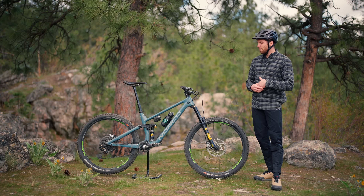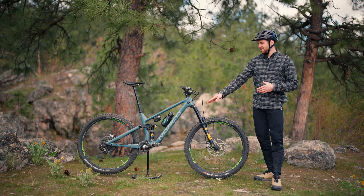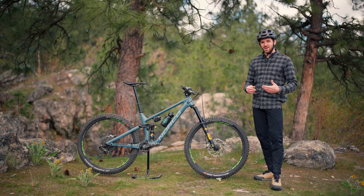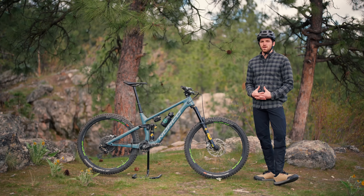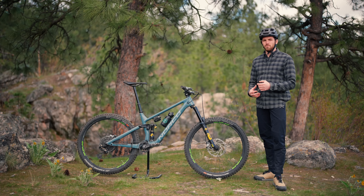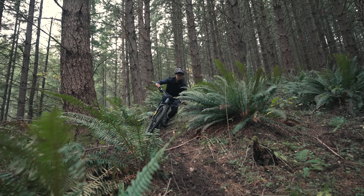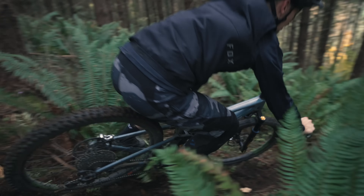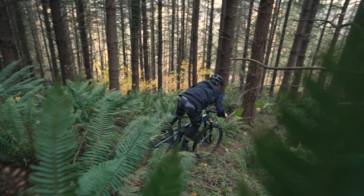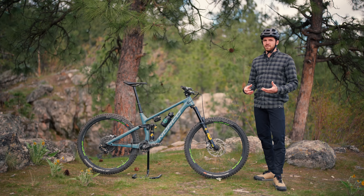I really like a fork that ramps up hard — as you can see I haven't used all the travel in quite a while. I like to leave that and find out where it comes in on the trail. Overall these settings give it a nice supple feel off the top with a lot of ramp-up and really good mid-stroke support. I actually prefer a little bit softer off the top — I don't mind the fork diving a bit. I've just adapted my riding to suit that.